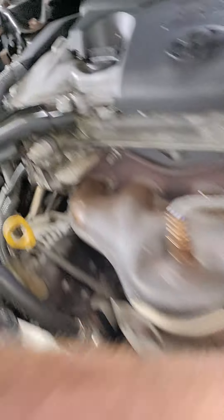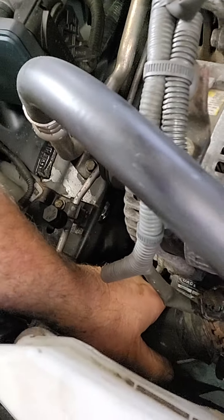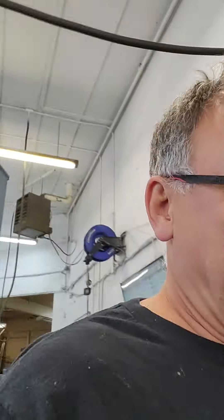I don't advise anyone opening the radiator cap if they can feel any type of heat in the system. Even though this is full, I know that this is not right. Touch your radiator hoses if you can. If you can reach your heater hoses at the back of the engine, grab them too. Once they're hot, that means the thermostat has opened and it's pushing coolant through the entire system, and it should be good — but that doesn't mean that it is.